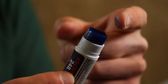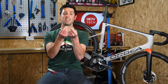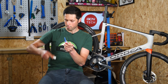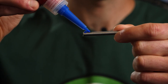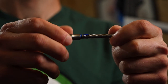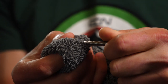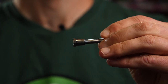To apply Threadlocker, it's super easy. The first thing you need to do is ensure that the thread on the components is nice and clean and free of any oil or other contaminants. If you've taken a component off your bike, clean it thoroughly and then make sure it's nice and dry. If you want to make life a little bit easier, you could just use a little bit of disc brake cleaner. Once we take our Threadlock, I'm going to use the liquid one here. You quite simply apply one or two drops onto the thread like that. You don't need to worry about putting it all the way along or spreading it around everywhere, providing you put it towards the end of the thread. As you fit the other component and thread it in, as it contacts the Threadlock it will spread around by itself automatically and go into all of the places that you need it to be. If you've got any excess, you can just get a cloth, wipe it off, and let it dry. Usually within a few minutes this will start to cure or set, and the full strength of the Threadlocker is achieved after a number of hours.